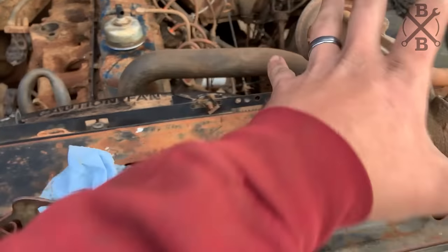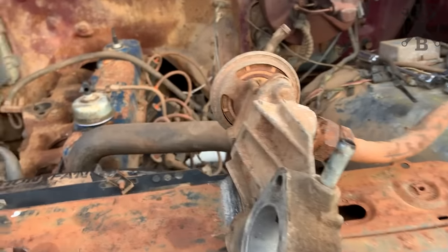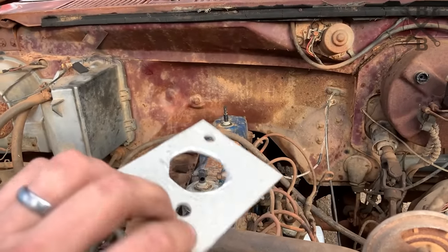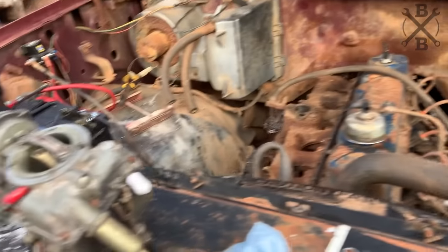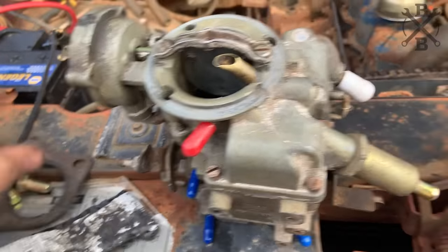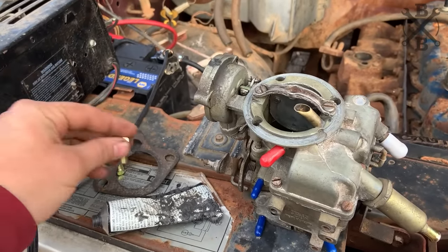And it just gets away from all these extra vacuum lines and stuff. As you can see, I went and capped everything off there. To do away with this, we've got this professionally manufactured plate that goes in place of it there, and you'll put our bottom gasket. Now, instead of using those long studs, we now have these little bolts.